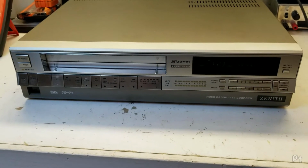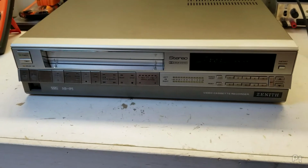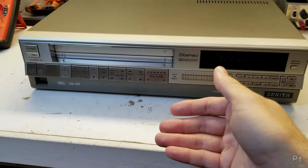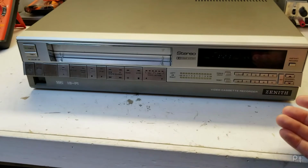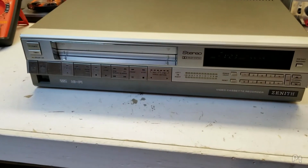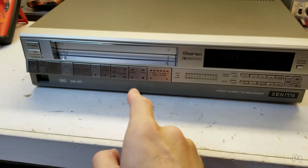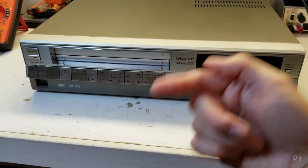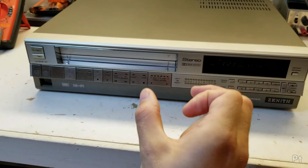So if you have a hi-fi VCR and you want to record a bunch of music, you can go out and buy a T120 and get 6 hours of music, a T160 and get 8 hours of music by recording in EP. And here's the other great thing. Hi-fi audio doesn't get worse when you switch speeds because it's still recording the same equivalent speed, right?